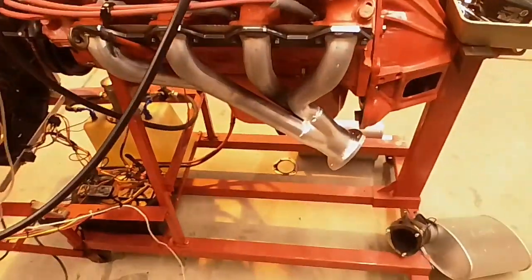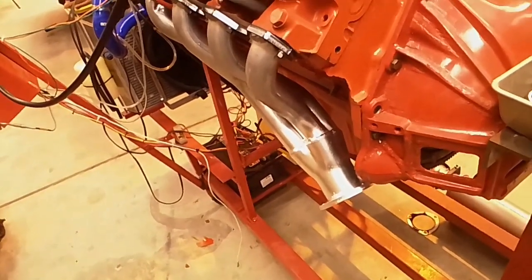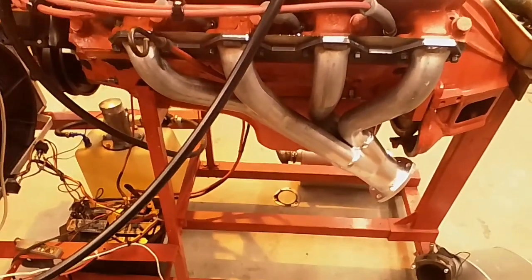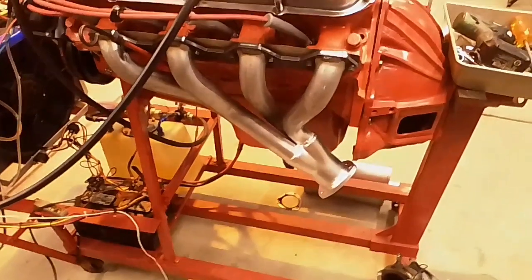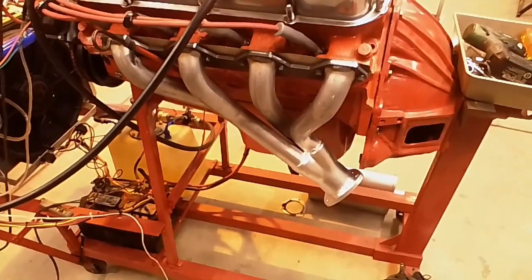The header on the driver's side — I love this side. It's gorgeous. It tucks in really nice to the block, kicks out to get just around the bell housing, and stays in tight. This is the driver's side, so you'll have trouble with the steering shaft on this side. But this is going to give you about as much room as you're ever going to get. The header is tucked up tight to the block, even at the bottom, and it comes out at a 45-degree angle. This side is just gorgeous — you couldn't do better than that.